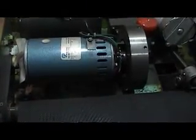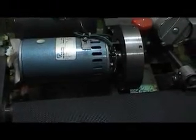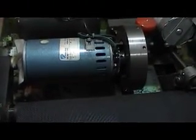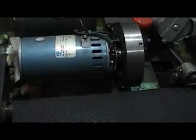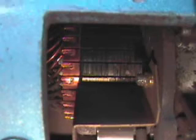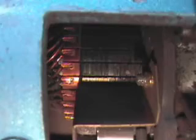If your machine has had a worn belt, then it increases amperage in the electronics, and the motor brushes can wear the commutator down. They can actually spark on the commutator and make them wear down. And the way that you have to find out if it's worn or not is if you have a motor that's got windows, you can kind of get inside and look.